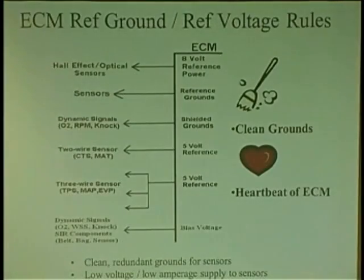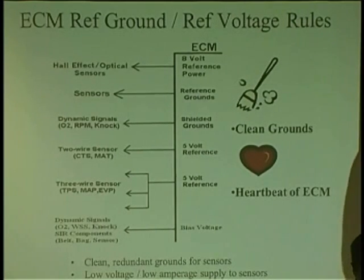Computer's not alive. John, when you're using a power probe to do a voltage drop, you're not connecting both leads on the battery? Well, I mean, you can leave both leads on there, but it's the ground one, because you have to power this up to see the meter. So you leave them both on there just to power up to see the meter, and then you're just checking the ground to see what the level is. And it's a quick check. You can go anywhere and check the ground with this, anywhere. But good question.